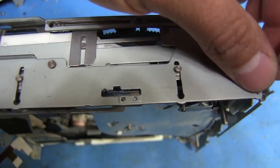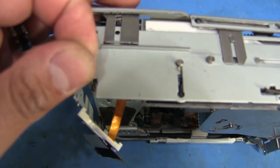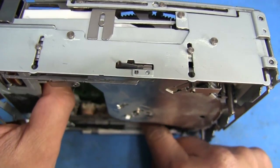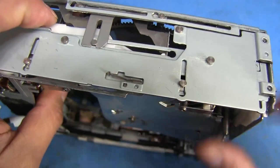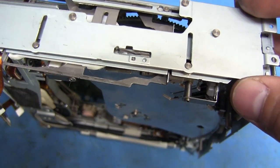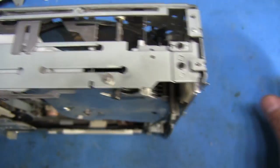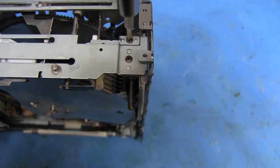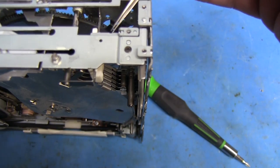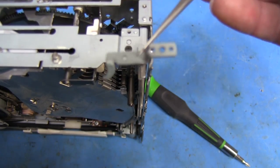The one in the back is covered up by this plate, so you need to undo these three screws right here — one, two, and three. Now those three are out. This will just lift up, but you need to move this whole inner assembly upwards so that this piece can be released. That comes off — this whole plate in the back comes off. And here's the other screw you need to remove right there. We take that one off, and that will allow us to pull this piece out, which is one of the ones that moves that whole little grabbing mechanism.